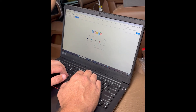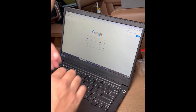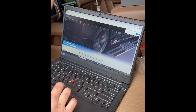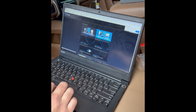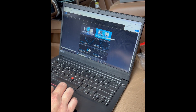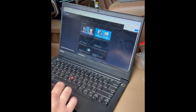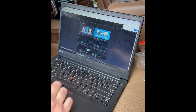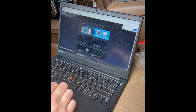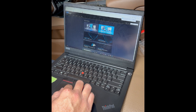Once you've got the laptop on and plugged into the MPVI, you're going to go to hptuners.com, Downloads tab. For now, you have to use the latest beta suite, which is on the right-hand side. So you have the latest stable version — that is not the one we want. We want to download the latest beta suite. So just click on it, hit OK. We downloaded the HP Tuners beta software.